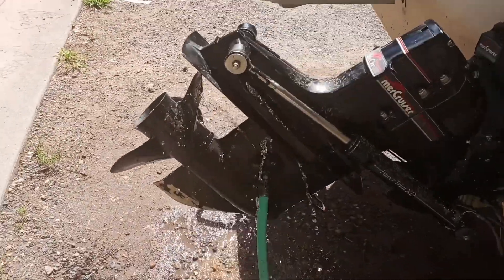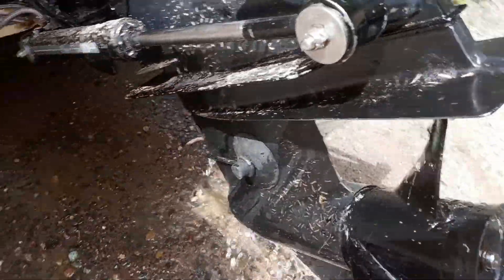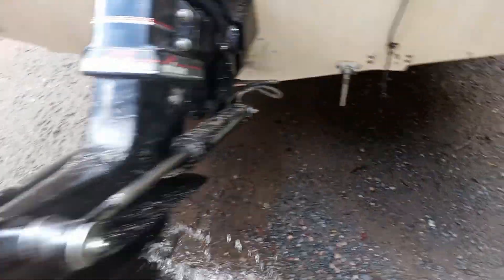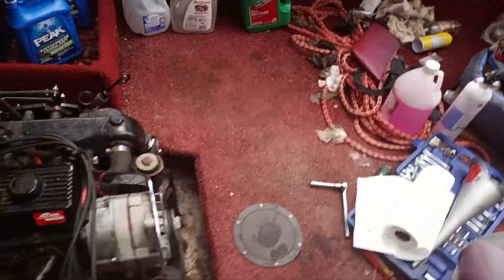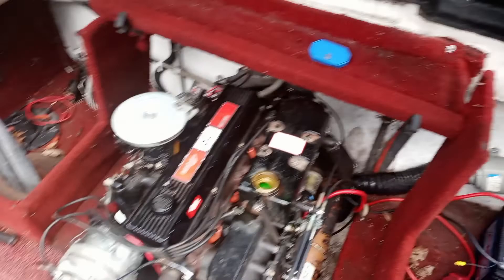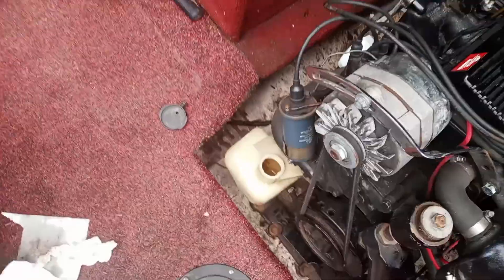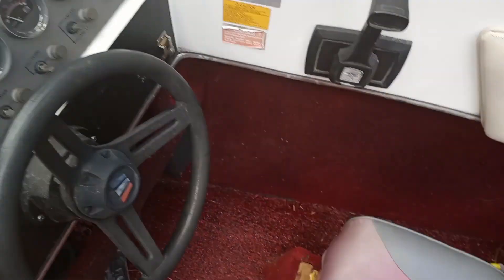Before starting any large boat, you need some water muffs like those so your water pump can get lubricated — otherwise they'll dry out when you start it up. So it looks like we are clear to start this thing. Let's go for it.